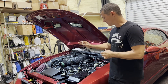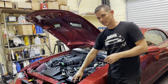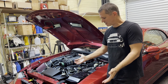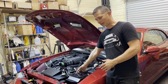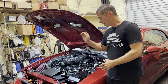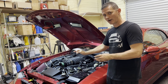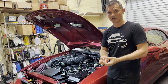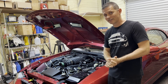The other thing I'm thinking about is the intercooler core itself. The temperature sensor shows fluid temps are about 100 to 108 degrees on a hot day, which is a little warmer than a trunk setup because it's pulling heat from the engine bay, but still well within reason and should be working fine. So if you've got decently-temperature fluid flowing through at a good rate, the only other thing would be that the core simply isn't absorbing the heat — it could be a bad core or clogged up. We're going to dive into this today.